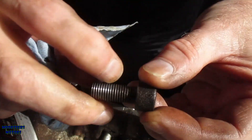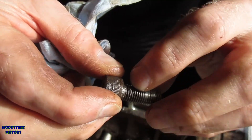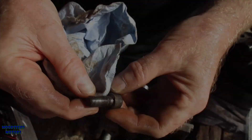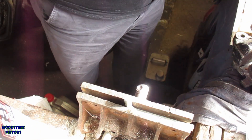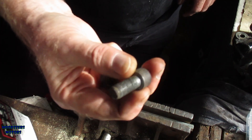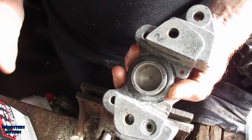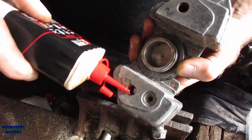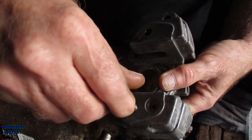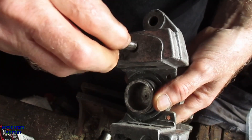Although that has cleared those threads, I can still see that there is some — let me turn it the other way so the light catches it better — there is some slight damage on the thread that looks to me more likely like corrosion. Anyway, that's done. Another one of those to do; those threads look pretty clear already, but no harm, we'll run it through. I should also probably run the holes out too, making sure they're nice and clear, because if there has been threadlock in there — which is quite likely — the threadlock will be just as caught up in there as it was on the bolt itself. And yes, it goes in part of the way and then it stops.